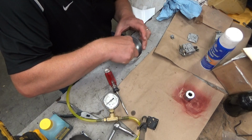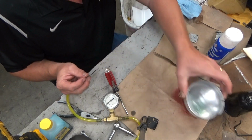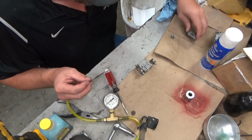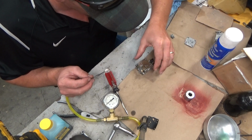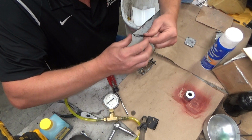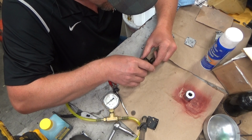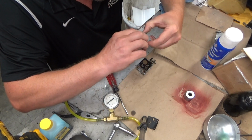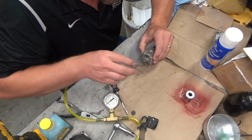Okay, so I decided to experiment, and I soaked this gasket in fuel. That was easily a couple hours, yeah. So let's see, just for grins, if it makes any difference. If it does, what that suggests is that putting one together and running it for a little bit is probably enough to seal up a minor leak.